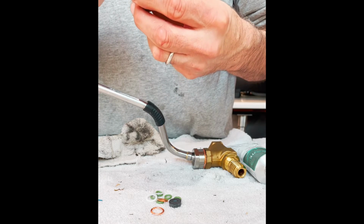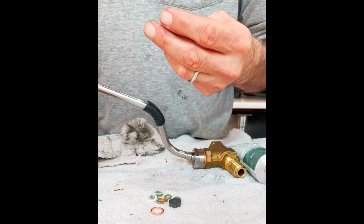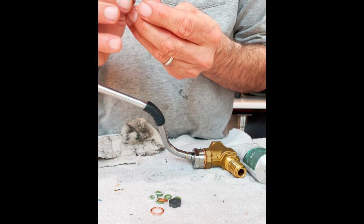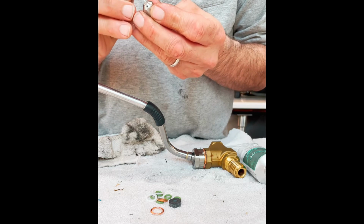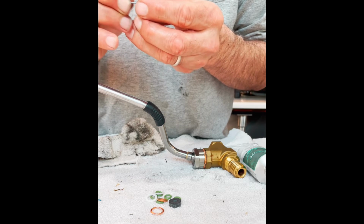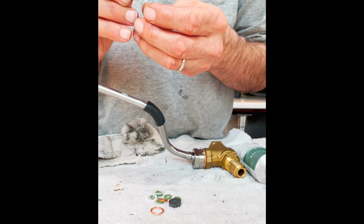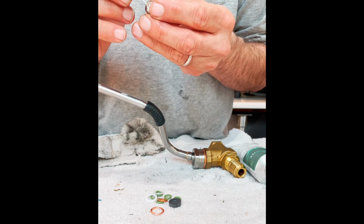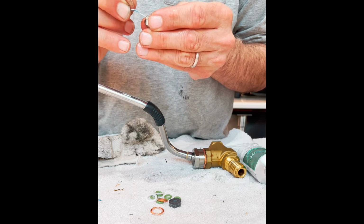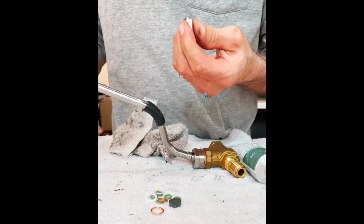The other thing I like to do, take a fine wire, or maybe you have an appropriate tool, is just make sure your steam passageways are clear. Be careful not to actually use something that opens up these holes bigger. It's just going to make the steam flow through a little more aggressively when you're steaming your milk, and it may not be what you want. If you ever damage one of those, you can buy a replacement. It's not a big deal.